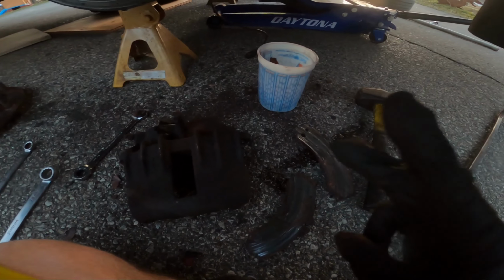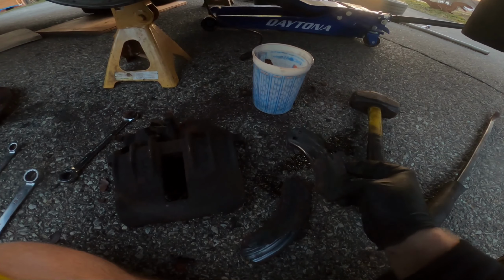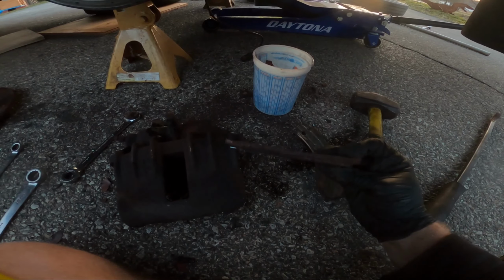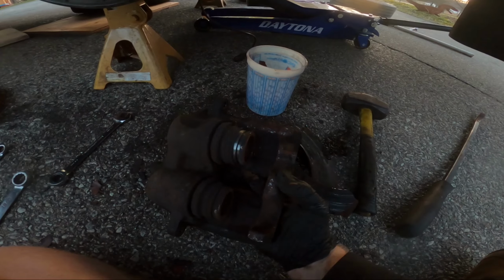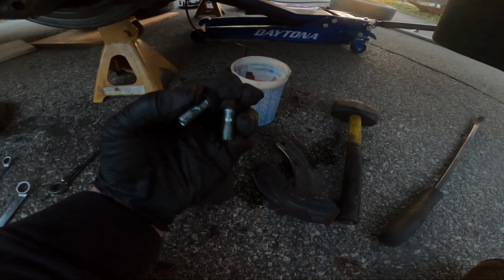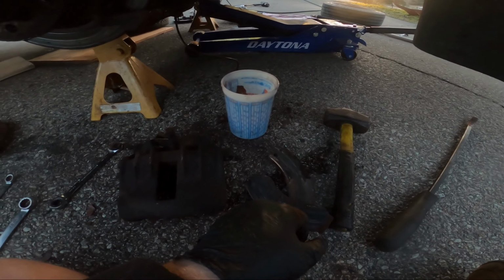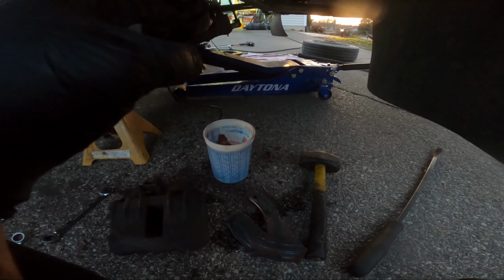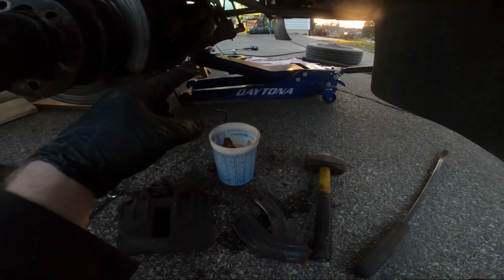Okay, two concerns. One, this side, well, aside from the brakes being completely worn from driving, you can see this one's really tapered. And on the caliper itself, this top piston won't go back and it's gone out so far the steel came off. But completely different style slide pin bolts. So I would imagine somebody bought the wrong parts, which means that side might be the wrong parts. This may be the original ones. And it just so happened that the bigger stuff fit.